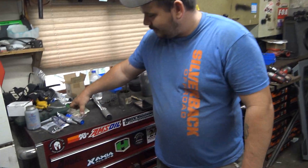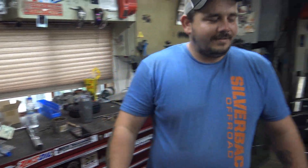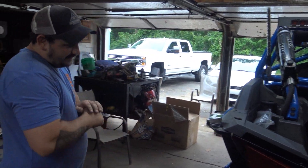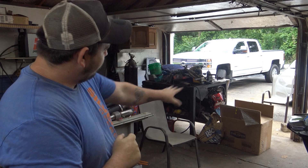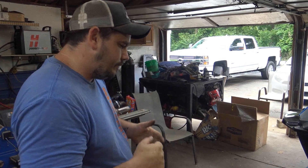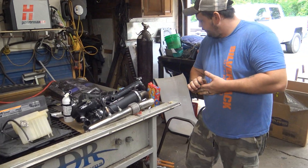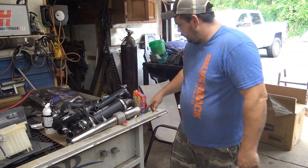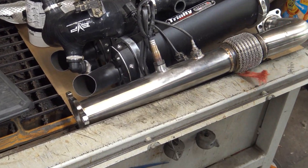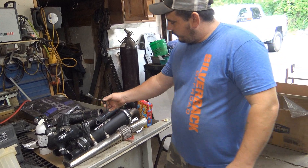You want to show my last $40? That's all I got left. Hey, we're going to start a GoFundMe for Tim — he needs more money for his build. I might as well just light one of them twenties on fire right now because that's what I'm doing with this money. Got the old blown motor boxed up in there real nice — that's a core going to get sent back, probably this week. Here's everything else: charge pipe, new exhaust mid pipe coming from the turbo. It's basically a stock pipe with AFRs, cut brackets off, got the bung welded in there, and the original oxygen sensor in there as well. Just trying to make it cleaner.